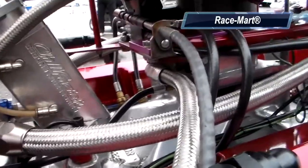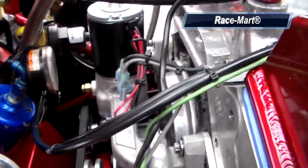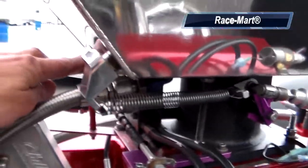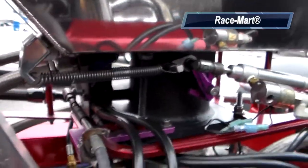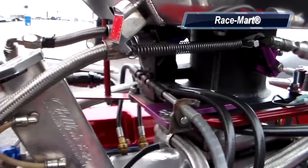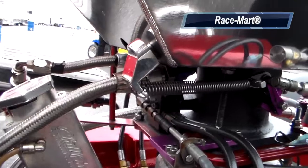The reason you need this primer pump, especially with a fuel-injected system like this, is because you have a low-mounted fuel pump that's belt-driven down here, and you've got to get that fuel all the way up your main fuel line into the throttle body or carburetor. A mechanical fuel pump just won't pump that fuel up that distance, so it's absolutely necessary.